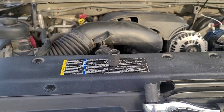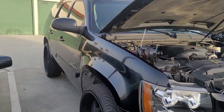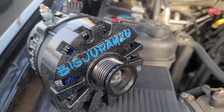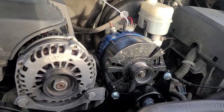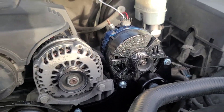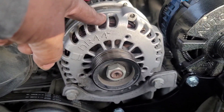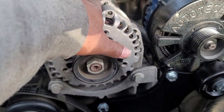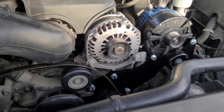Hey YouTube, Instagram, it's Biggeray20, getting the project together — 2007 Tahoe LTZ. Over here working on the alternator. Got the Biggeray20 Autotech Engineering 370 amp alternator and another 370 amp alternator. They're both billet-style casings, and I have the stock right here of course. I'm going to be relocating the stock down here and redo the wiring. The stock alternator is going to be charging the truck itself, and the two Autotech Engineering 370s will be charging the lithium for the audio side.